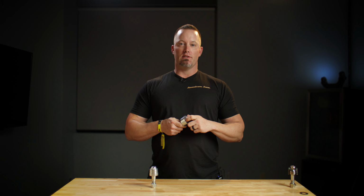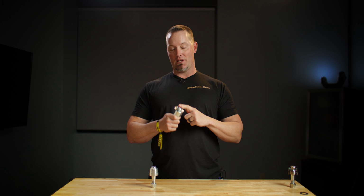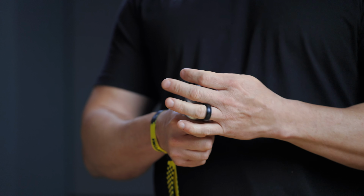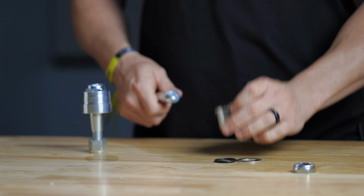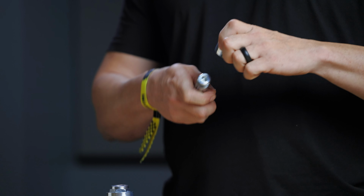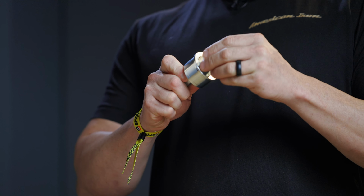One of the reasons the delete system is superior to some of the other joints out on the market is we keep it super simple. You do not need set screws, wiper seals, all this adjustment stuff unless you like adjusting more than you do driving. Literally, there is a greased spherical, C-clip, seal, shim, nut. There is not a bunch of complicated little parts in there to fail and wear.